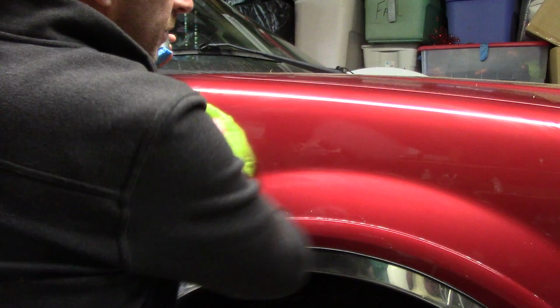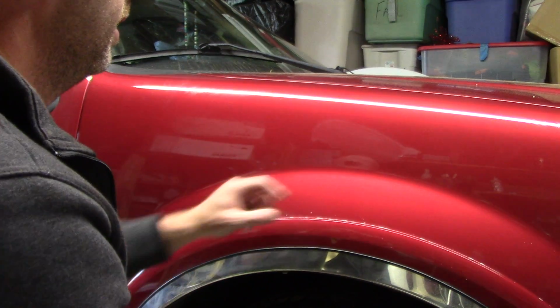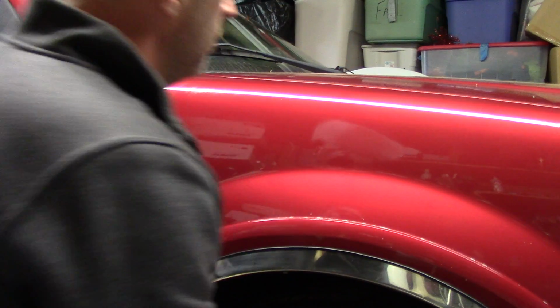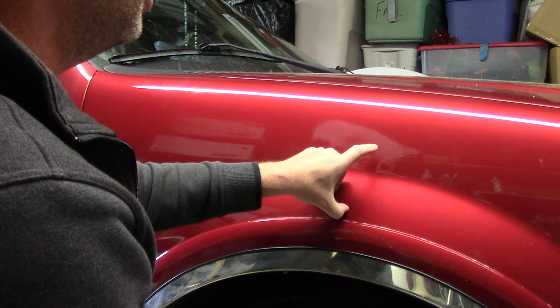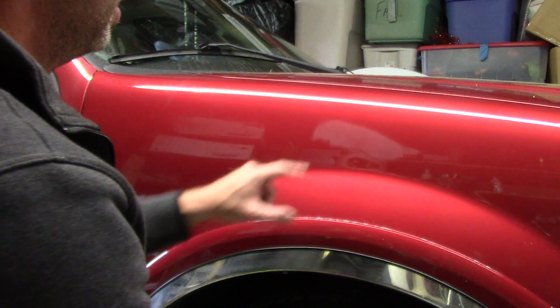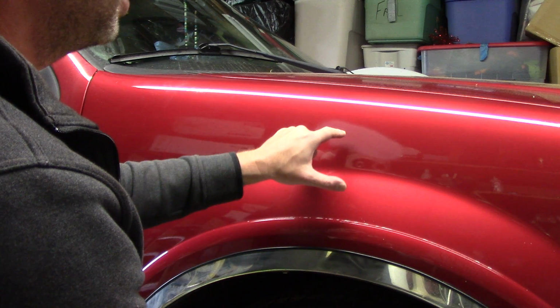remove that fluid from the scratch, and then I want to start seeing, I'm sure the video's showing it, how I've abraded the paint. I want that to evaporate. What I'm looking to see here is, does my scratch disappear from the scratches I created with the 2000 grit sandpaper? I want to meet it at its level. There's a little bit more scratches underneath there.